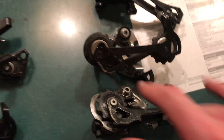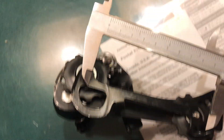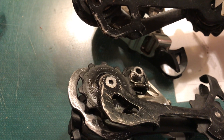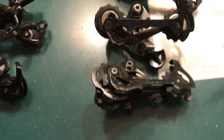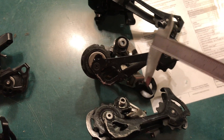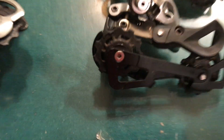The actual center-to-center measurements aren't always exact — all three of these are within 10 millimeters of each other. This one is around 98 millimeters center-to-center, this one is around 90 millimeters, and this one is 86. They're all long cage though, so you can't just say 86 millimeters is a long cage. There's a range — I'd almost say 80 millimeters and above is long.